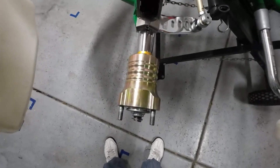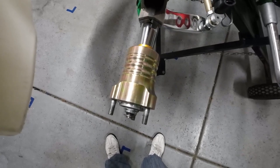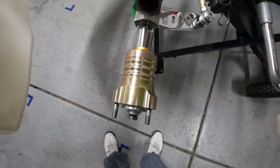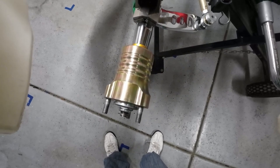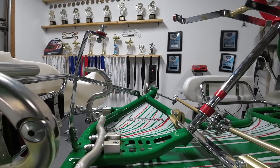For anyone not familiar with steering sweep, we're essentially just going to measure how far our wheel turns. As we're turning the wheel, you'll notice there's going to be a point where the hub will pause and it'll actually start coming back the other way — similar to using a dial indicator when measuring for top dead center.